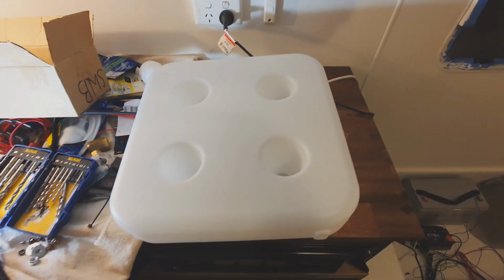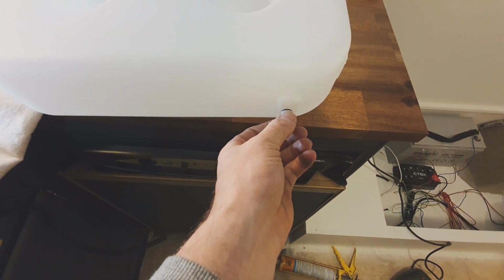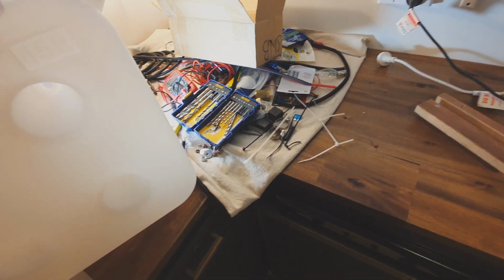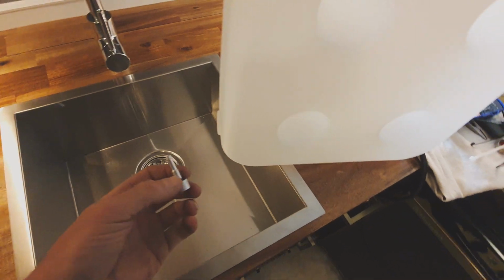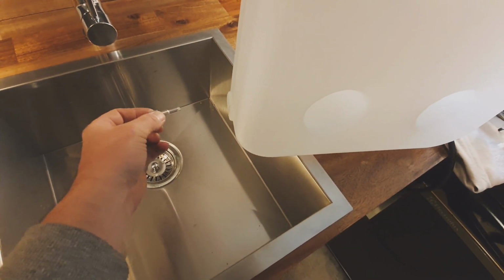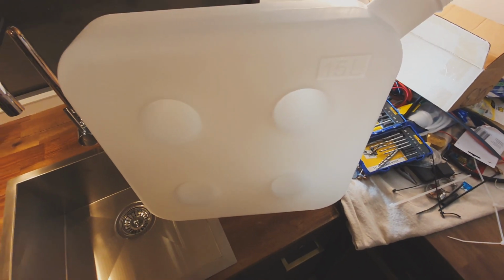I'm sure all the kits are a little bit different, but in my case it was a 9mm hole for that barb to go in. 8 didn't cut it, it was a 9. So I think from what I learnt doing the first way around, the easiest way to get this barb, because it's got to go inside the tank and then out that hole, is you can spend half an hour of your life putting it in there and jiggling it to get it out there, and you might get it. The easiest trick I saw was just run a bit of wire down through here, or obviously you go this way, you run your wire in the end and then back out the feeder, and then once you've done that you can just slip this down the wire until it pops out the end and grab the barb. So we'll do that, I think.